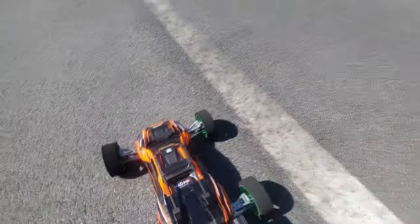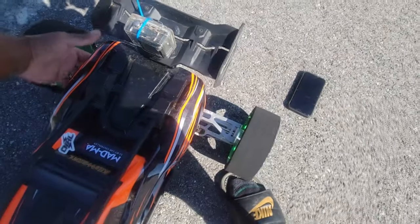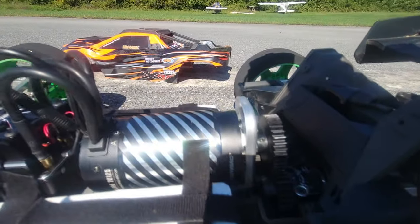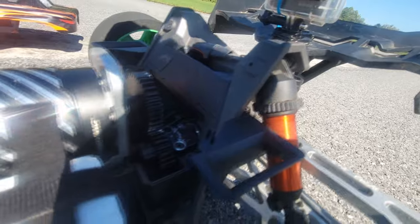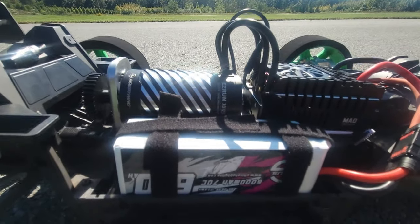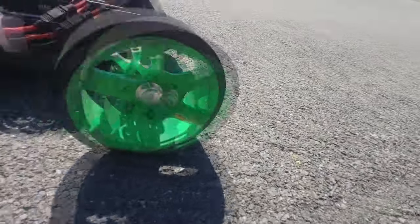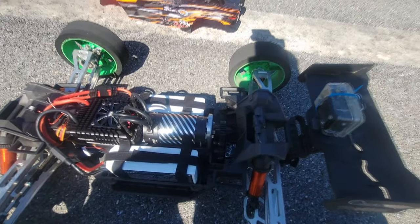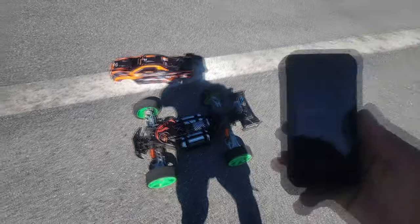All right, so let's see what's under the hood, guys — don't be shocked, because this is Kilowatt RC, this is what we do. We are running 16S. We got the brand new Mad Components Max 21 16S ESC running in sensor mode with the big huge slug of a motor — HobbyWing 70-125 560KV. We got the Kilowatt RC Mod 1.5 gears, pinion and spur, with the PNW RC Madness 8mm spur shaft. We got the brand new China Hobby Line G Plus 8S LiPos — brand new, didn't even break them in. Got the OG Gone Bananas racing skin wheels and the WFO Y kit. First pass, not even geared crazy, and it just did an easy 122.